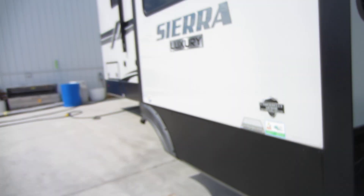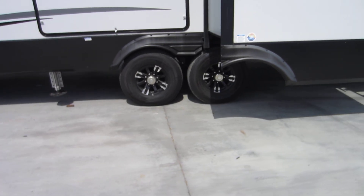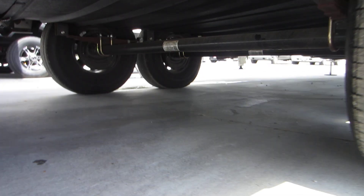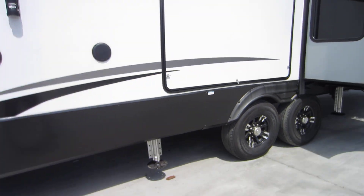Here's the storage area on the underside. It's also going to need two new axles and leaf springs all around. The two axles on it are bent, probably from being overloaded, and so are the leaf springs. The rest of it looks good underneath. There's a lot of potential here in this deal.